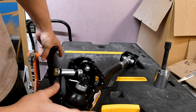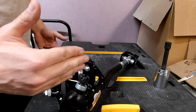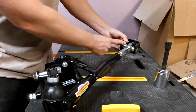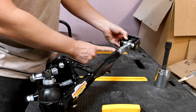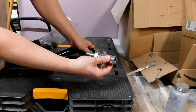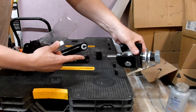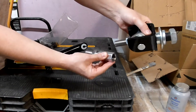The length of this strut rod is adjustable, but it's not to be used to adjust your caster — just to get the lower control arm in the correct location so that the bearing in it doesn't bind. It has double threads on it: left-handed threads coming out of the control arm into this nut, and then right-handed threads on the second half of the piece.